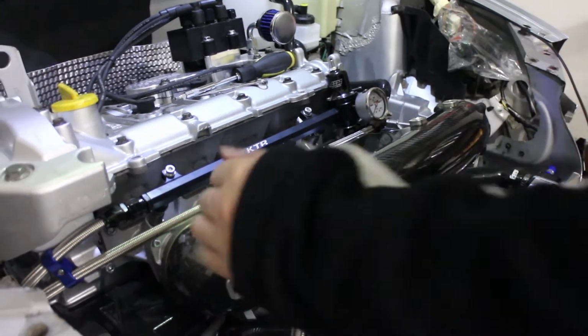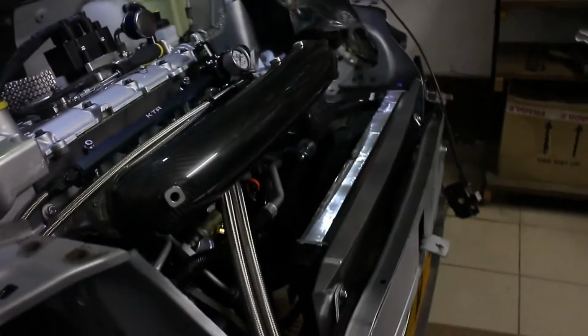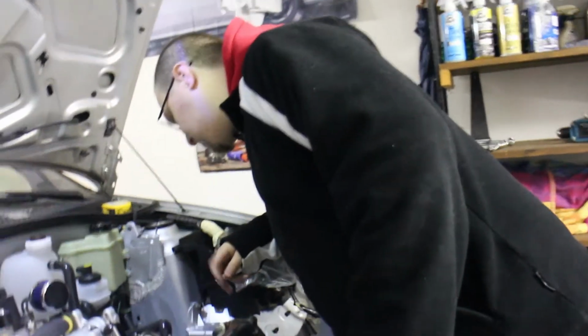Well, that's pretty much it. Now the fuel lines are done, and the fuel rail and the regulator. It's so sexy. But what's next? Oh yeah, this is a master plan. So now that this is done, the next thing is to put oil in the engine, into the oil cooler and the pipes, and tighten everything around the oil cooler. Once that is done, according to the plan, we tighten all these servo hoses. We need to do these before we put on the intake, otherwise it's suicide. And those there, but those I think are tight.